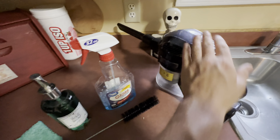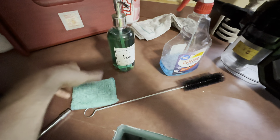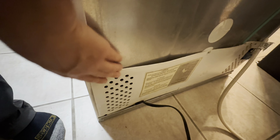Who wants to be shelling out money to have people fix the refrigerator when you can just do simple maintenance yourself? I'm gonna show you what tools you need. You're going to need a vacuum, some Windex, an old rag or paper towels, dish soap, a sponge, one of these wire brush cleaners to clean the coils, and a quarter inch socket - it might be different on your fridge - for the cover plate bolts on the back.